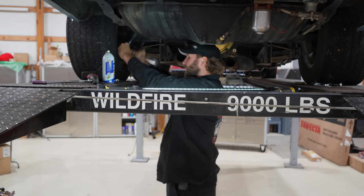Well, got her all finished up here. New hardware throughout. These are the bolts I pulled out. Now the rear end's just tired, needs to be refreshed. The bushings were so bad, and the bolt was loose. It was sawing through the bolt right here, about ready to go, but now we've got it washered up and lock nuts on both sides. I'm going to keep that in mind, got some ideas for the future, but for now, everything's locked, bolted in, nice and tight. We can move on to tires and the fuel.